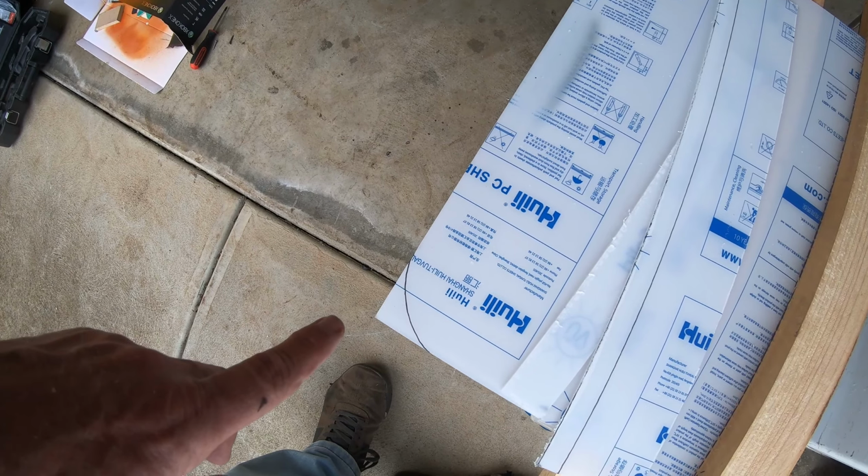It's extremely important that when you cut Lexan, you do so slowly. By cutting Lexan quickly, you are creating friction which causes heat, and heat melts the plastic. It creates globs of yuckiness that you simply don't want. So go slowly, take your time, there's no hurry, you can even stop and come back.